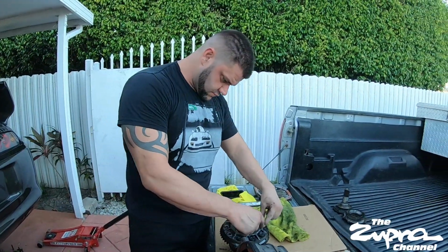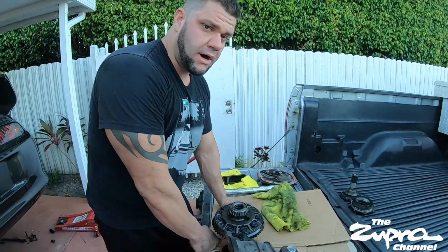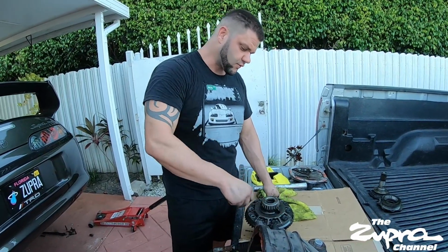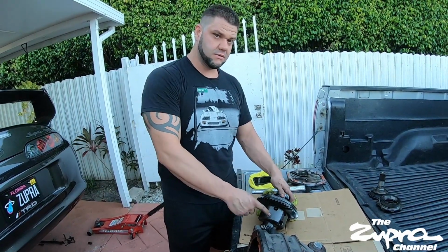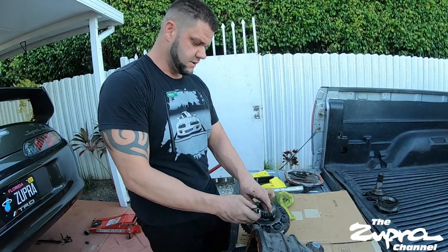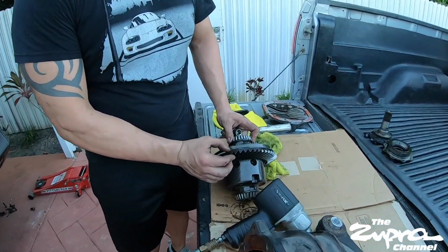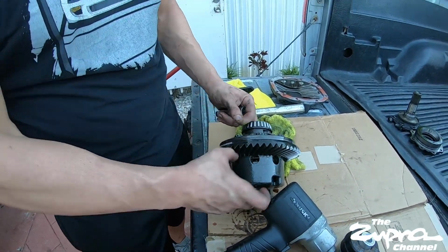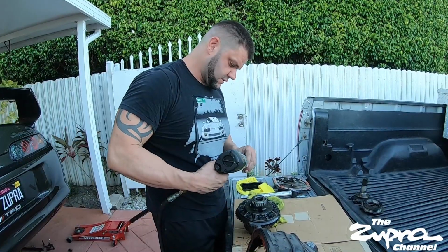These are, what is it, 2, 3, 4, 5, 6, 7, 8, 9, 10. Okay, so the turbo autos and every other diff that I'm aware of have 10 bolts. The 6-speed is a bigger case and it has 12 bolts. So the actual unit, the LSD, is different. There's LSDs for the automatic units, and there's LSD for the 6-speed manuals only. So obviously it's a beefier differential. And when they say 200 millimeters, this thickness of this metal, it is a 200. The 220 is thicker, so you have a beefier tooth. That's why they're stronger. But like I said, guys, those things are like $4,500 now compared to about $300 for one of these.